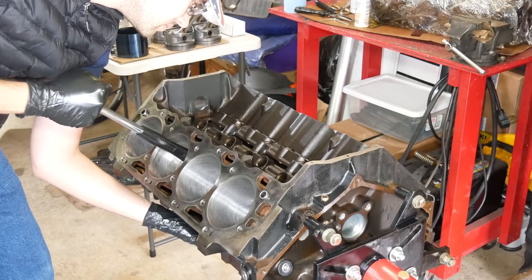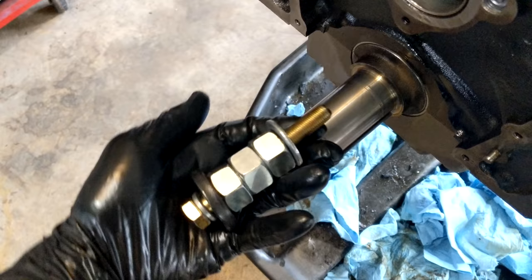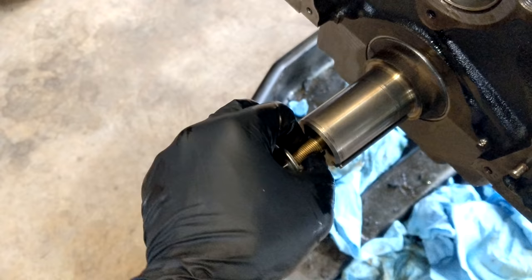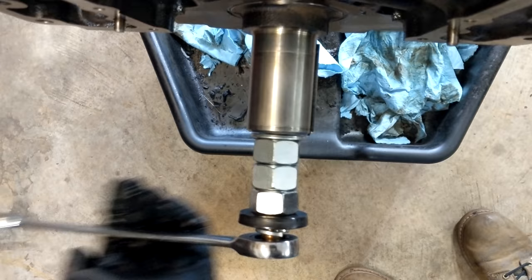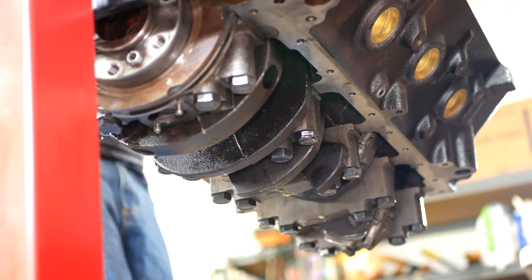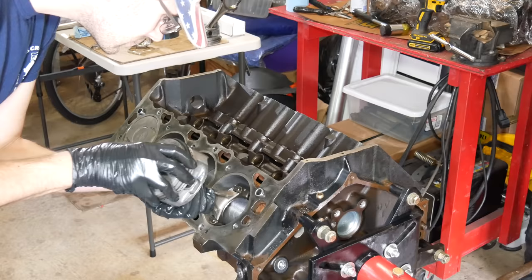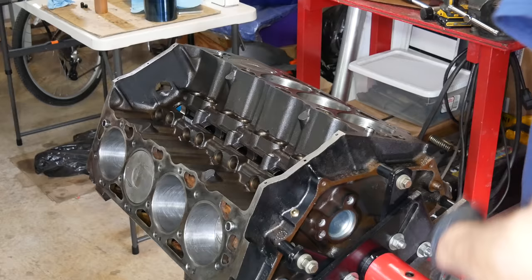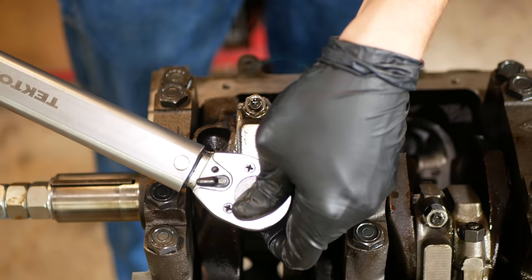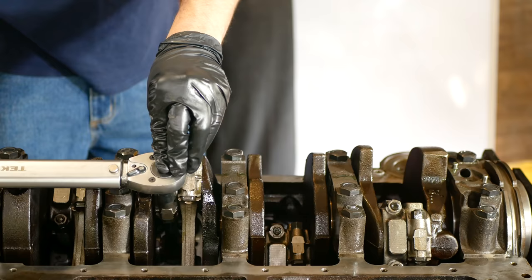With number two in place we'll take care of three and four as well. Now that we have a few pistons installed the crankshaft isn't so easy to turn and we're going to need a bit of assistance to rotate it to install the rest. To do that we'll thread in a half-inch 20 crank bolt with a few nuts and washers on the end to keep it from bottoming out, tighten that down into the crankshaft snout, and use it to turn the engine over. That'll make it easy to line up the crankshaft journals for the next few pistons. Now we can install five, six, seven, and finally eight. With all of them installed, we can flip the engine over to torque down all of the rod caps — starting at the front and working our way back, tightening in even increments all the way up to 48 foot-pounds.